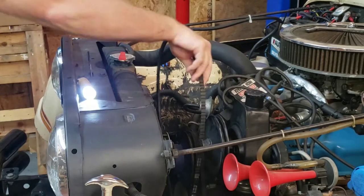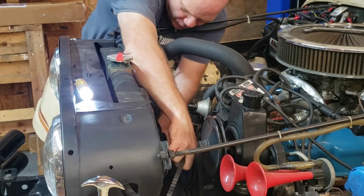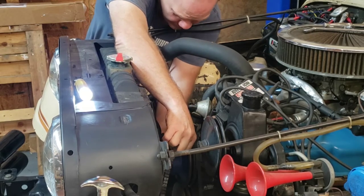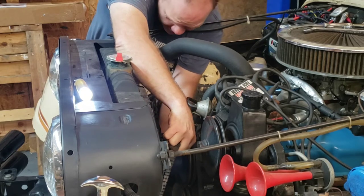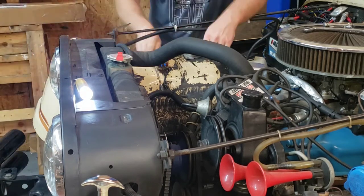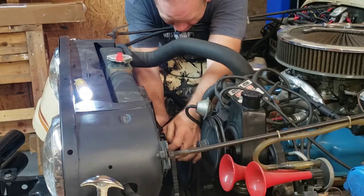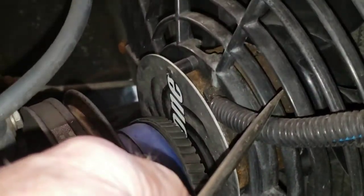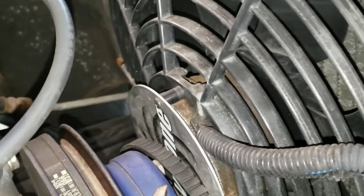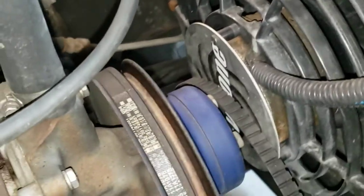Alright, we've got some belts here and I've got an electric fan on this old Jeep. So I have to turn the belt sideways and push in on the fan a little bit to get it past the pulley where the stock fan used to be. A little more gentle persuasion with a screwdriver — that's what you get when you have a kind of a custom setup. So we have the electric fan, which is an aftermarket add-on. I removed the clutch fan years ago. There's a little bit of a tight fit here, but you have a little bit of leeway — I can press in just a little bit and we can get that fan belt clear.